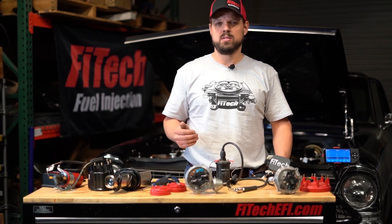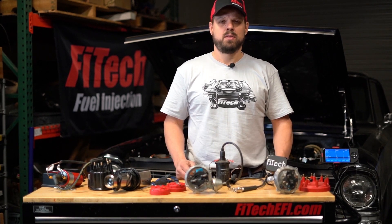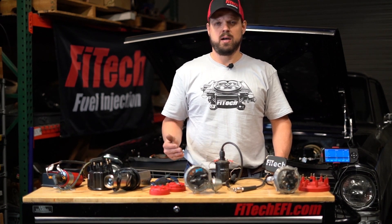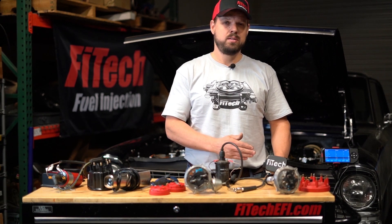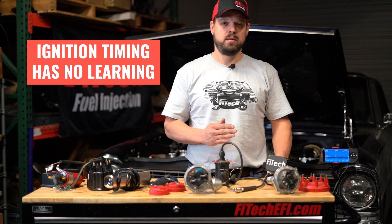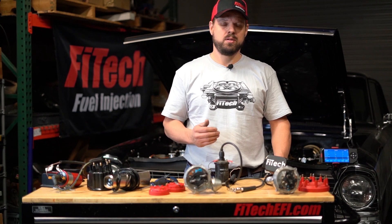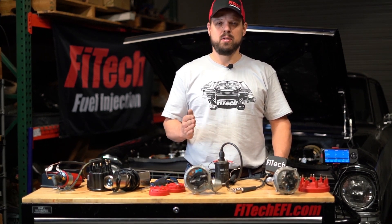You can experiment to see if your engine misfires if you advance further than 42 degrees. Our throttle body and Ultra Ram ECU do not use knock control — knock control would detect knock and retard the timing, but our system does not utilize that and does not learn anything based on knocking. So if you're experiencing knocking, you will need to manually reduce the timing in the range where you're experiencing knock, typically at lower RPMs and medium to high loads.